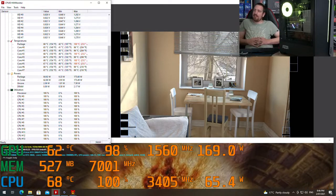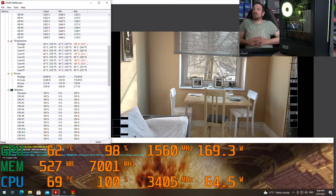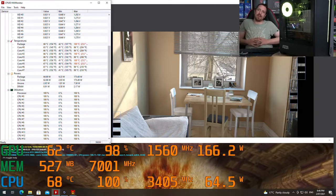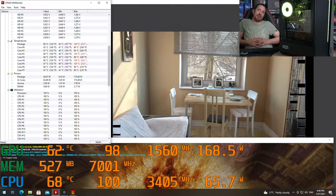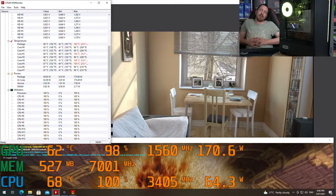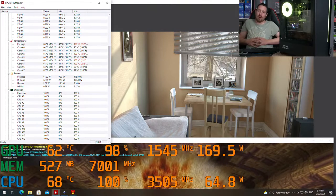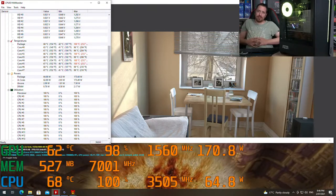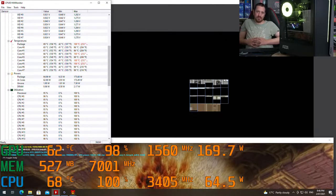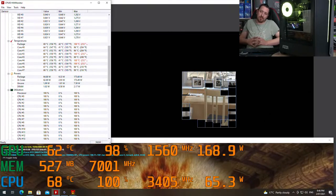Whereas with the F-series, they're not. Half the things in there are grayed out. So if you've just got an F-series CPU, you can download XTU, and really anything that you adjust in there, you can't really hurt anything too much, because you can't adjust any voltages or clock speeds. All you can do is turn off limits. So you can turn off the turbo time limit, you can turn off the turbo power limit, things like that, and then you will get a bit of extra performance out of your CPU.